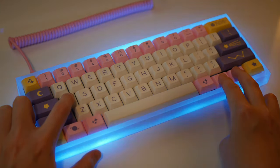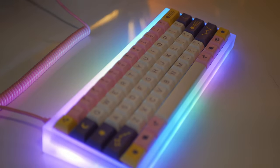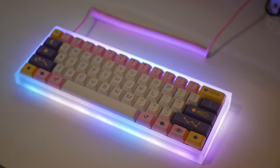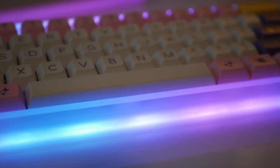I also really like typing on the board. I think the board feels really solid. And I think the Holy Panda switches lubed feel a bit better than when I was using them before I lubed them. I probably overdid it with the lube on some of them because I don't quite get that tactile feedback anymore, even though I didn't lube the legs. Overall, I love how the keyboard feels — it's a pleasure to type on. There are some stabilizers that feel a bit iffy though; the backspace definitely needs a bit of work, but I've been a little lazy to deal with that just yet.